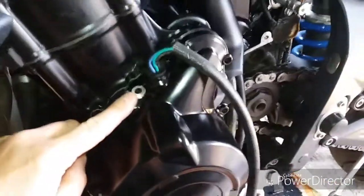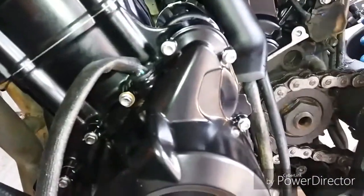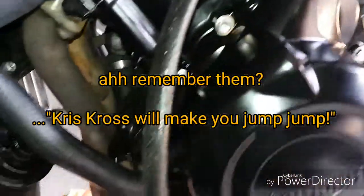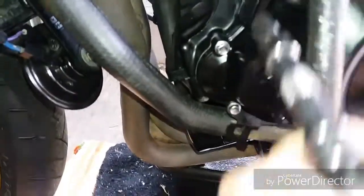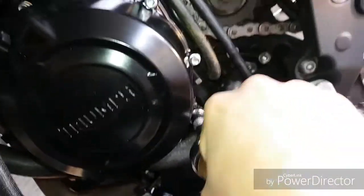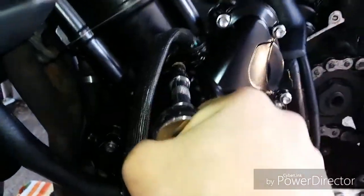That's all on. This one here, that's where your copper washer goes. So I'll get that out and put that first bolt on. Okay, so what I've done is I've put all my bolts in, only finger tight. What I need to do now, obviously, is tighten them all up. We do this in a crisscross pattern, so you get even distribution across your gasket. I'll work around them all. That's my crush washer there.